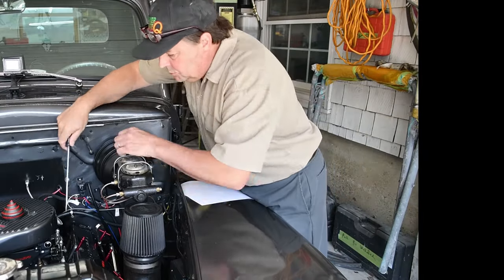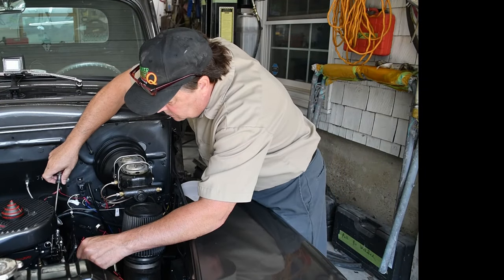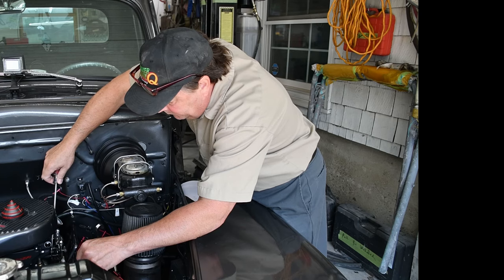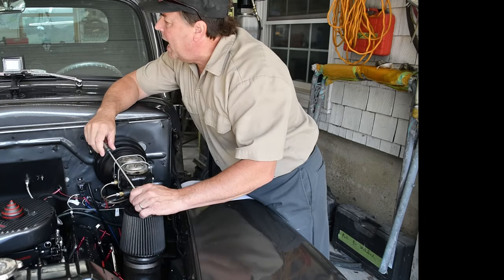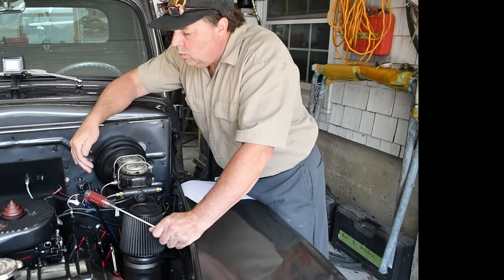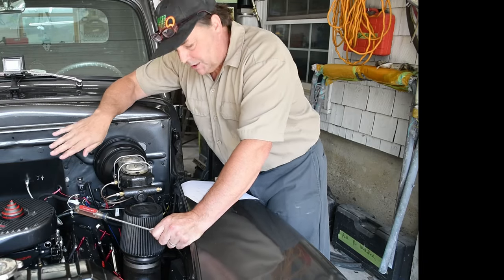Okay, so I have my screwdriver. I'm going to come over here, and I'm going to put a turn on this. I'm going to crank it right up. Now when I start it, it's going to be revving kind of high. We're going to watch the IAC, we're going to back it off, and we're going to feather the gas, the throttle a couple of times, and we're going to watch that drop down.